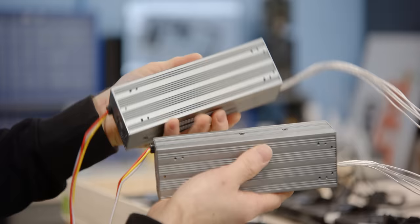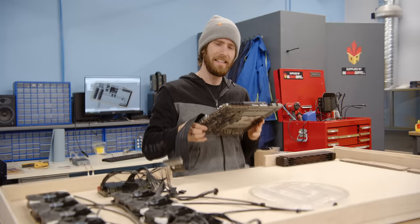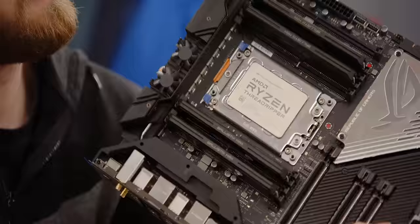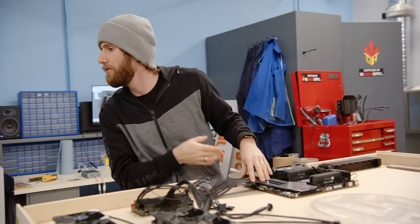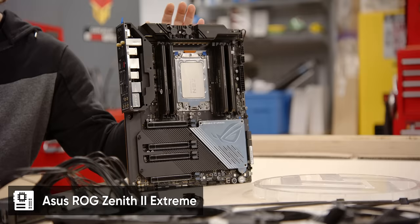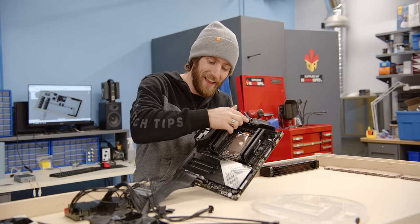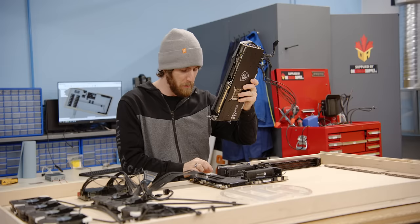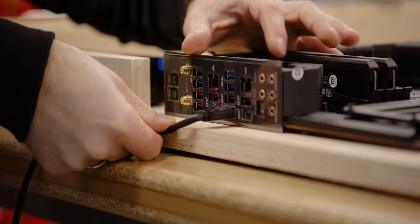Let's talk motherboard. Because AMD sent it to me, I'm using a Ryzen 3970X on an Asus Zenith 2 Extreme — it's the non-Alpha, which is fine because we are not going to be overclocking this thing anyway. We had to make a couple of small modifications to the board. It was so close to being too thick to fit in our case that we actually had to remove the cover on the VRM fans as well as the cover on the I/O, so it'll look a little more industrial. Just like last time, we're going to be setting the motherboard and the graphics card back about an inch or an inch and a half from the edge. This allows some room for the cables to bend or have large connectors before they butt right up against the wall.